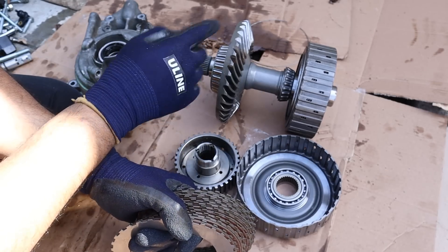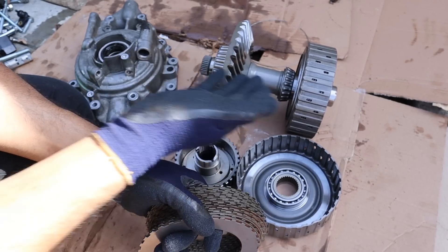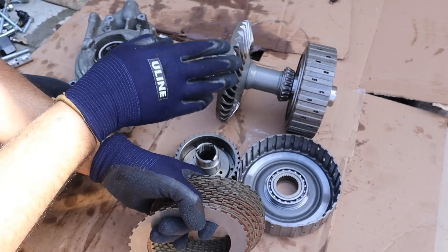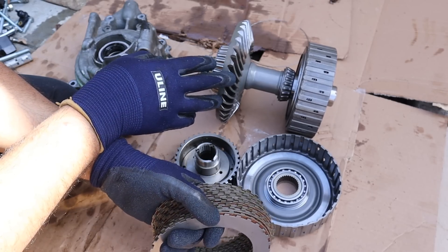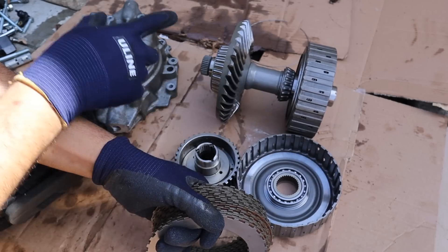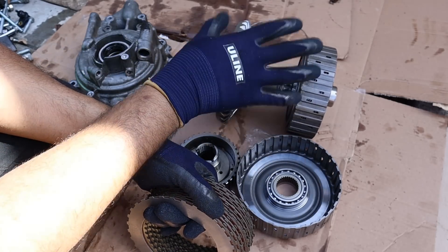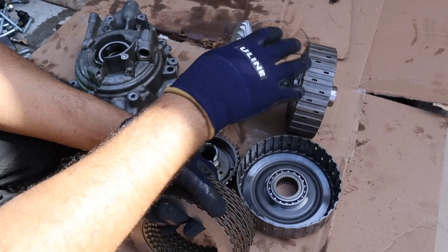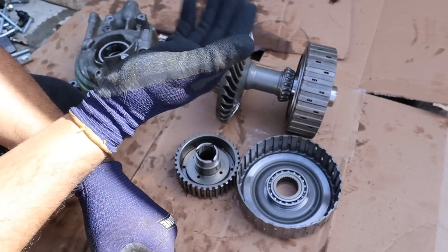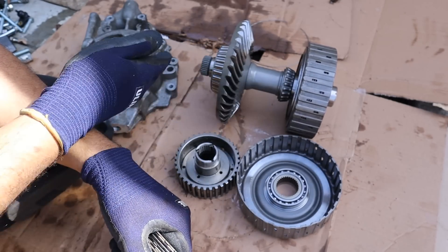A 50/50 torque lock split is good for off-road situations with gravel or loose surfaces — it basically functions like a locking differential like on a Jeep. You don't really need that with a torque vectoring differential because the computer is going to sense that a wheel is spinning and stop applying torque there and apply all the torque on the other side. It's worth noting this is more of a reactive setup, so the vehicle's angle needs to change in order to release one clutch pack and apply it to the other, whereas a Torsen limited slip differential will automatically control the torque to whichever wheel needs it.